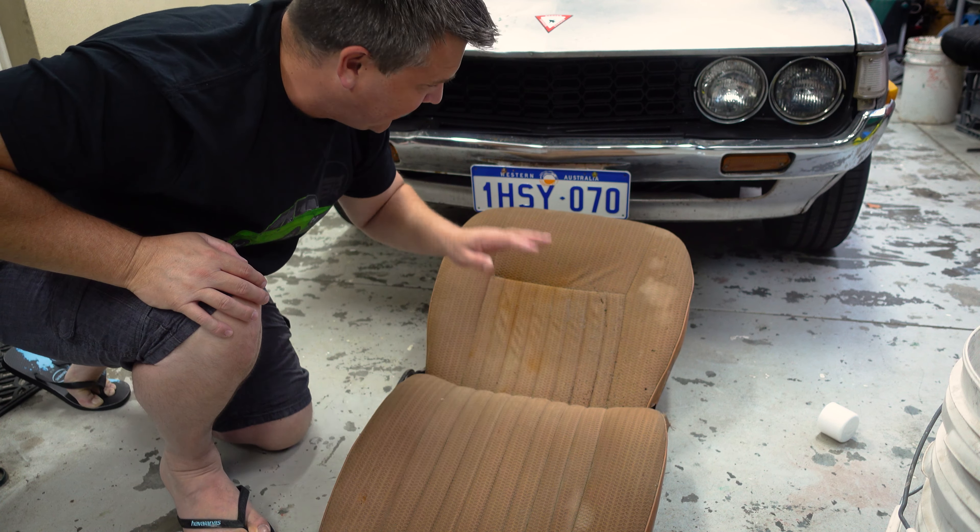This thing has been drying overnight. It came out really, really good. That Meguiar's product seems to be earning its keep. The vinyl on the back is not quite as nice, but I'm pretty sure that spraying over it with the vinyl dye is going to hide a lot of those sins. Now before we go blasting this with the black dye, on the vinyl I have vinyl dyed before and I did find that in certain instances it sort of scratched or flaked off. So for this one, because we've got such a big amount of vinyl on the back of the seat, I'm going to scotch-brite it. I've got three scotch-brite pads — green, gray, and white — and I'm going to have half the back of the chair just normal vinyl, and the other side broken into three bits: coarse, medium, and fine. We'll see whether once we've painted it, any marks from the scotch-brite show through. On the fabric portion, there's really no need to do any prep work other than the cleaning we've already done.